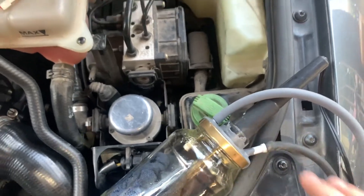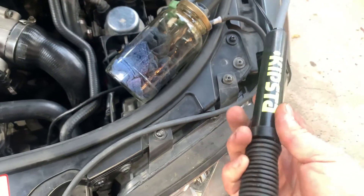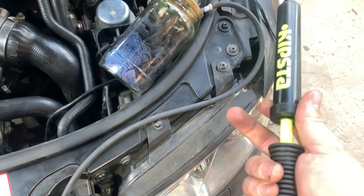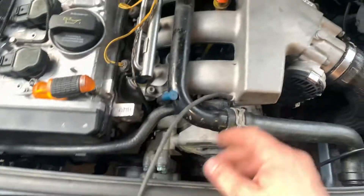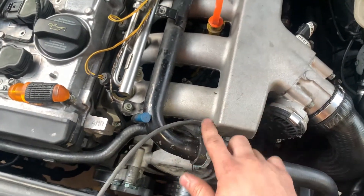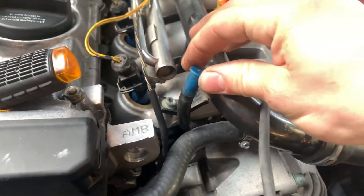I've made two fittings. We've got inflow of air, which I just use this little bike pump to pump it up. And it'll push the smoke into the system, and then we have the vacuum line that actually enters the engine. I just broke into the system through this little port right here and then plugged my vacuum line with this little cap.